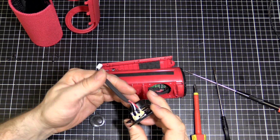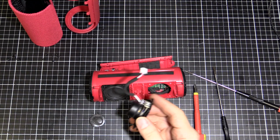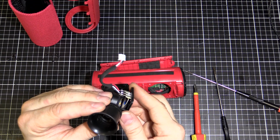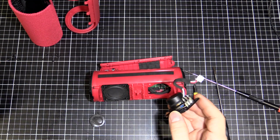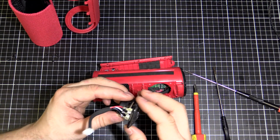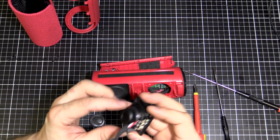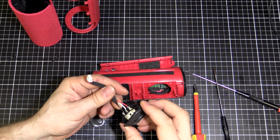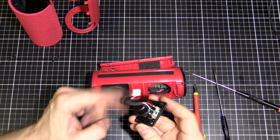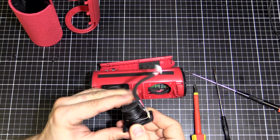It has 3 connections to it. That's interesting. Let's have a look, see if there are 2 voice coils. No. Maybe it's a grounding thing, like for interference, because it looks like it's connected to the case. See the center one there? It's punched through. So it looks like that white one is connected to the case. That's interesting. The black and red are the ones being used for the actual coil. Alright, well, I'll plug that back on.